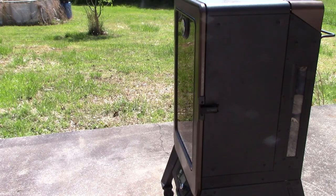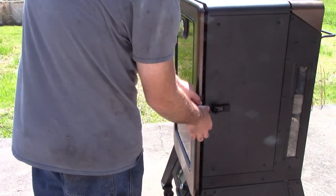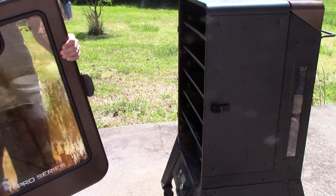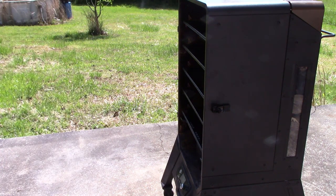The second step I'm going to take is to take off the door. The reason I'm doing that is just to make it a little easier and make sure you don't tilt it the wrong way and end up breaking the glass in it. Open the door up, lift straight up, and set it in a safe spot so it won't fall anywhere.